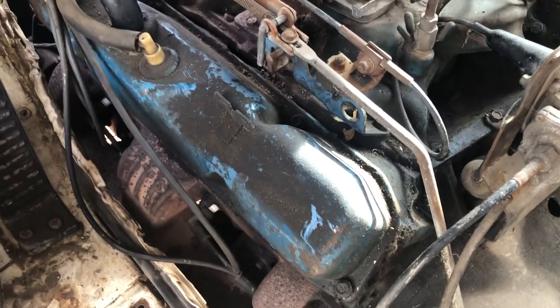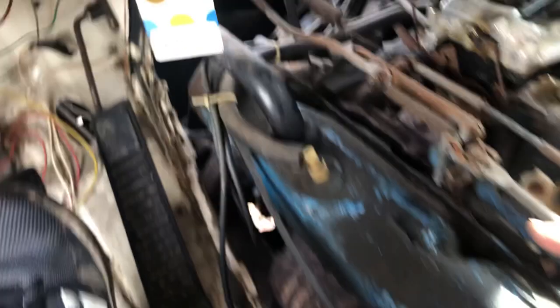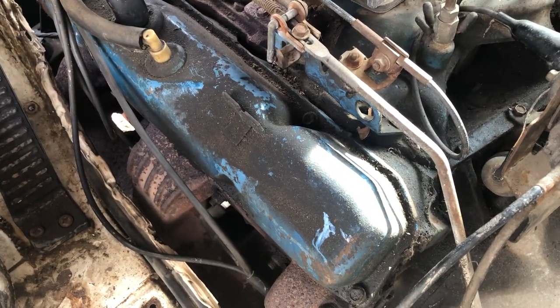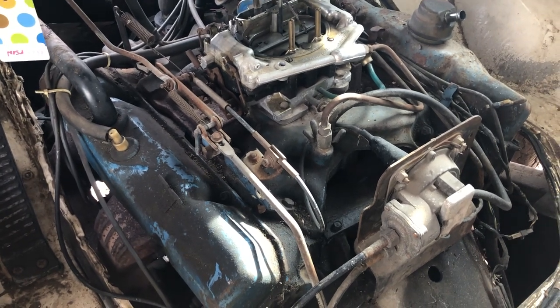This 440, as I'm assuming with all 440s, has six bolts in the valve cover - one at each end, two on top, and two on the bottom. I'm going to remove those off of the one side just to make sure the oil pump is providing pressure and getting oil to the top of the engine. You gotta love these old engines - they practically take themselves apart. That's not such a good thing actually. Over time things rattle loose, so all the valve cover bolts were essentially finger tight, which leads to leaks. That's why you get oil drips here and there.